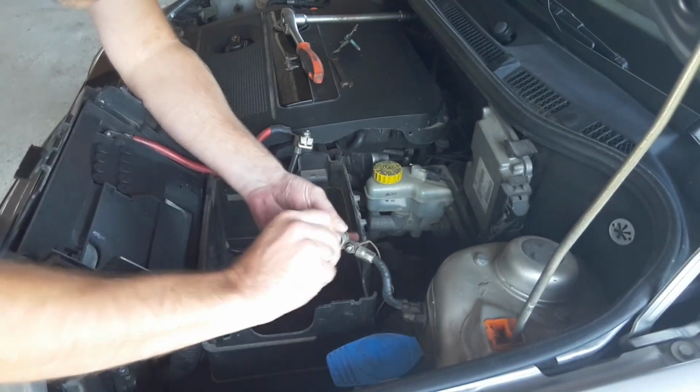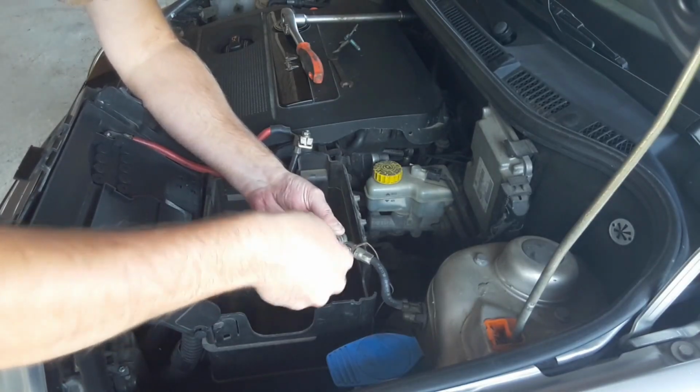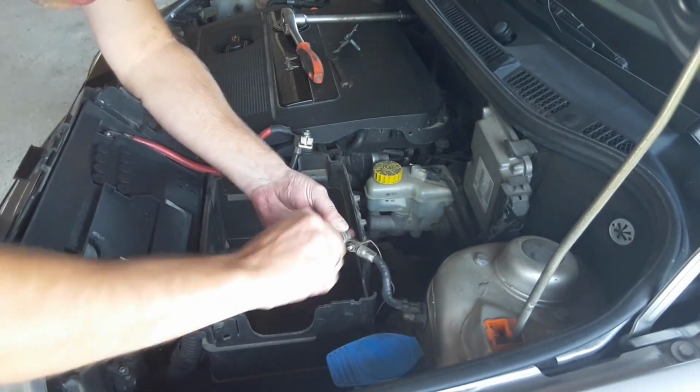Now, I wouldn't say that this is a definitive sign, but at least from what I've seen, the residue comes from a certain chemical reaction within the battery, and those chemical reactions happen when the battery is on its last legs. In that case, you can try to clean the terminals, clean the clamps, put everything into order, return the clamps, and try starting the car. But at least from what I've seen, this will not help. So when you see this large amount of residue, be prepared to buy another battery.